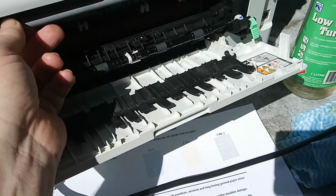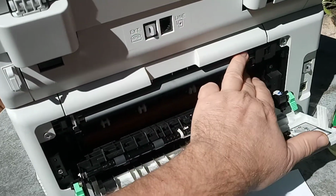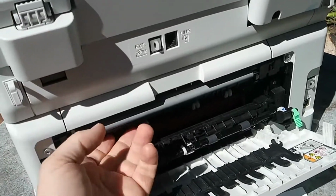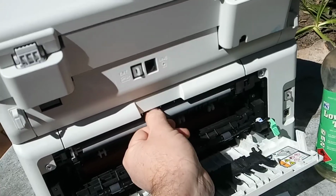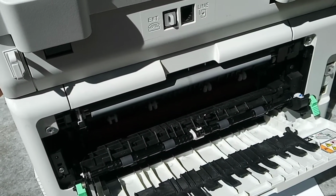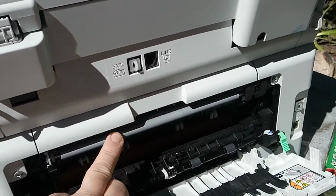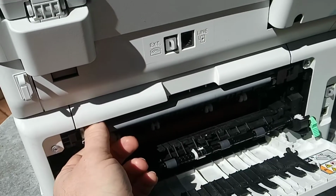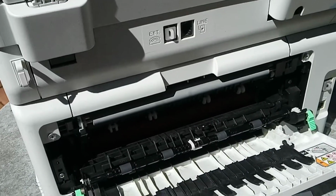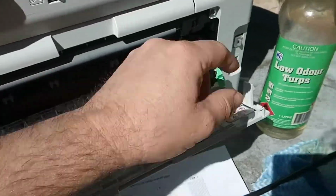So these rollers end up being coated, and on some printers that get a lot of use, this section of the printer can actually become quite wet, and it will actually drip water in certain areas. We don't tend to get it in Australia because it's a very dry place, but wet places like the UK, New Zealand, just really humid areas, this is a bit of an issue. And we typically only see this issue in Australia at 100,000 pages when the output rollers get coated in a real thin layer of what's like an oily tar. So what you need to do to solve this trailing wrinkling issue is clean all the rollers with turpentine.